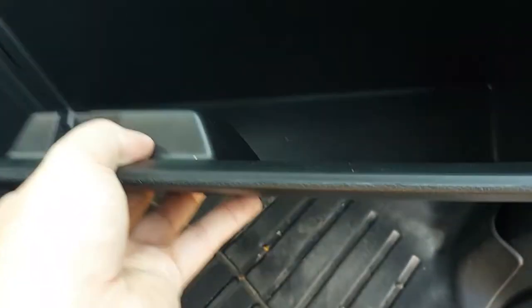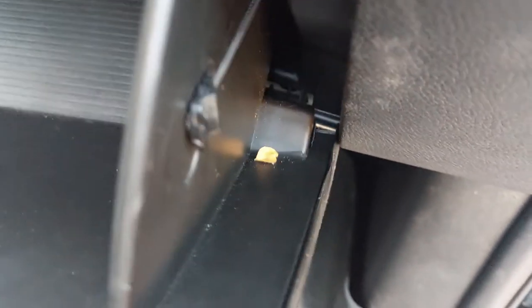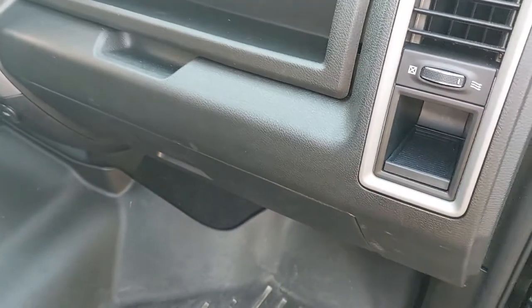Now to put the glove box back. To put the glove box back, all you're going to do is line up — you can kind of see it there. The first one here won't pull out too much more. You can line up both sides. You're going to press downward and then push up so the clips go back in. Just like that, and just like that you are finished.